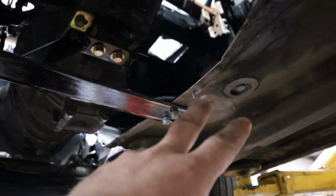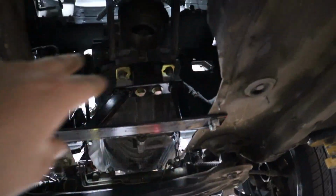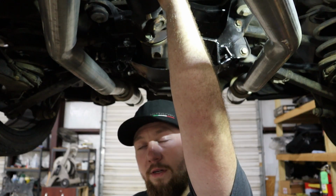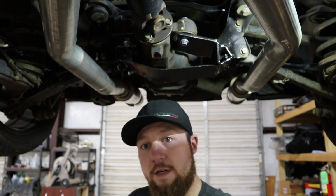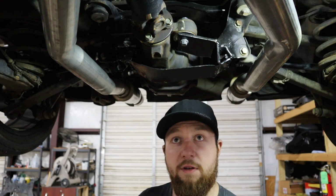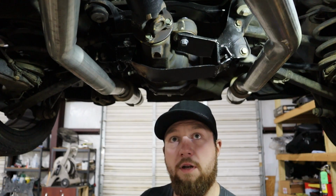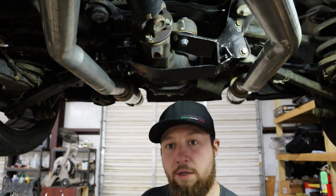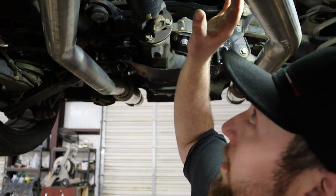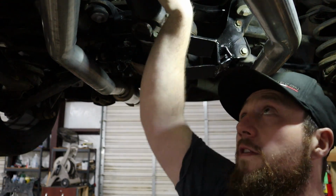I'm probably gonna weld braces in here, close that, and then I cut the upper part and reform it. But first we're gonna make some braces for here. I welded it in completely in position, and actually the drive shaft from the transmission down here fit perfectly in there. I wasn't expecting that. I expected to get a custom drive shaft, but it's pretty much good. It slides out of the transmission about half an inch, so we have a little bit of room there. That's the original drive shaft, basically.